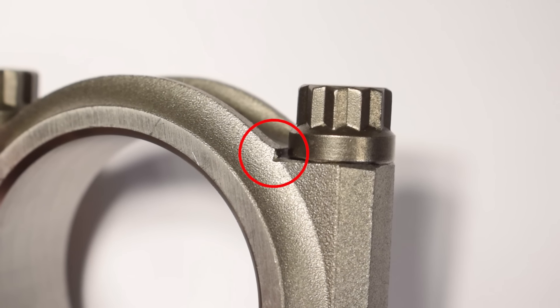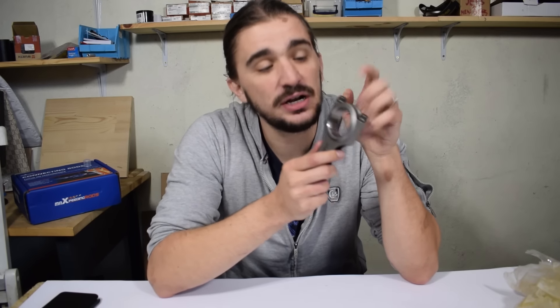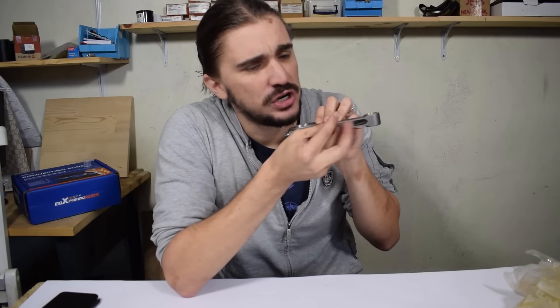Is there something I don't like about them? Well, yes. What I don't like is this tiny little sharp corner right here. It's a very minor thing and you could say I'm nitpicking, but although it's very tiny you could potentially call this a stress fracture point. I would prefer if this sharp corner was blended into the edge next to it. That said, you can remove it yourself with a small file in about two minutes. Also this edge on the underside has a very small degree of sharpness and roughness, but you can remove that with some sandpaper in about five seconds. I'm going to do both of these things before I chuck these into my engine — very minor issues, but I wanted to mention them.